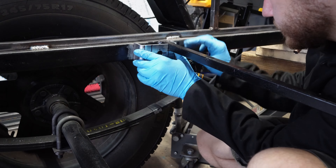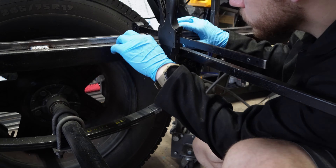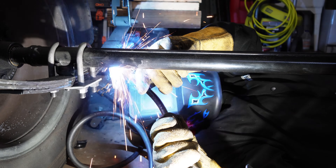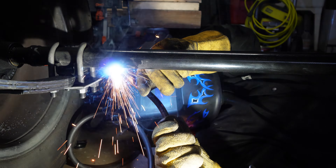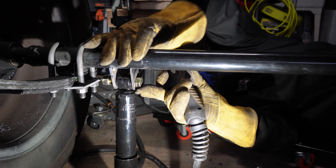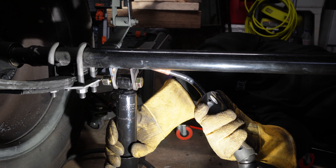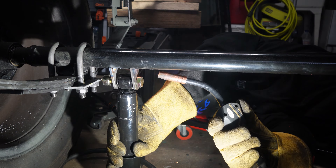Once grinding everything away, take your parts and put them in the correct spot. Clamp them in place and then weld them in place. I recommend you just do a couple tacks to keep it semi-permanent so that you can test fit it. Welding upside down kind of sucks, so this is me welding a tab upside down. Once I got my first tab welded on, I took my bolt and shock and ran it through and tightened it up for an accurate test fit. I just tacked this in place so it's not permanent and also it doesn't melt the shock, because this will very easily melt that rubber bushing.